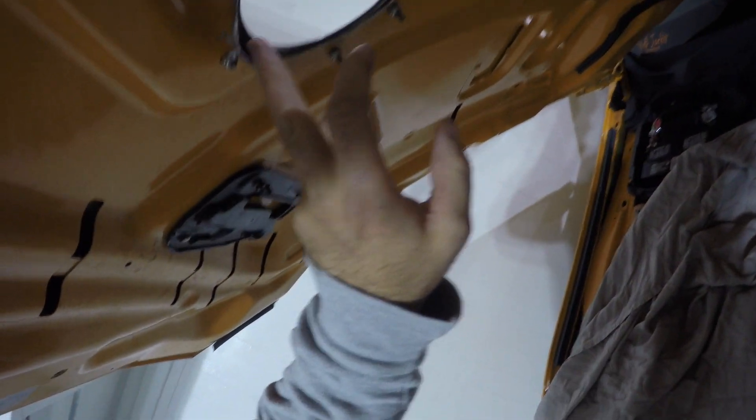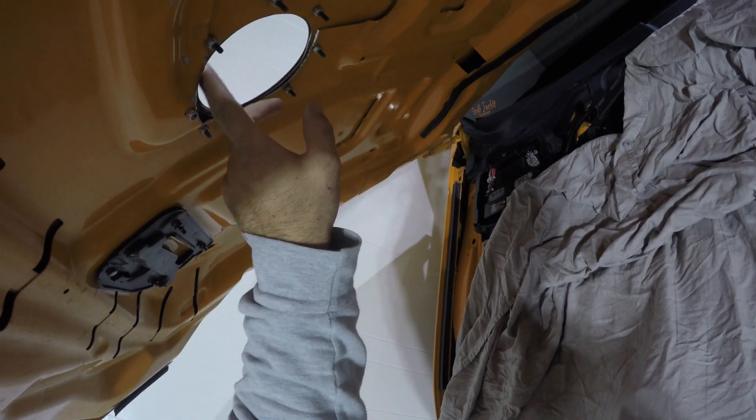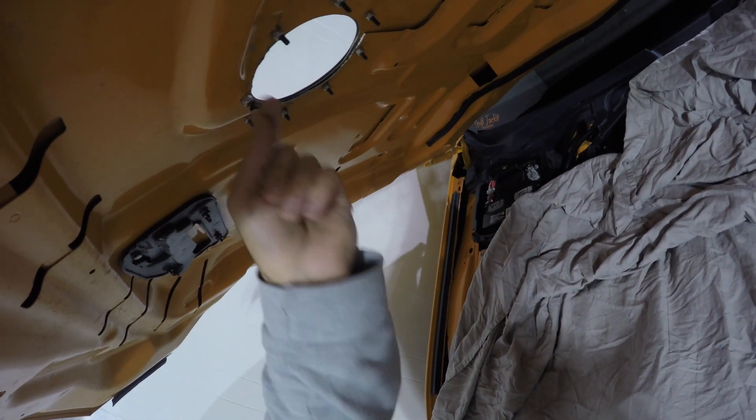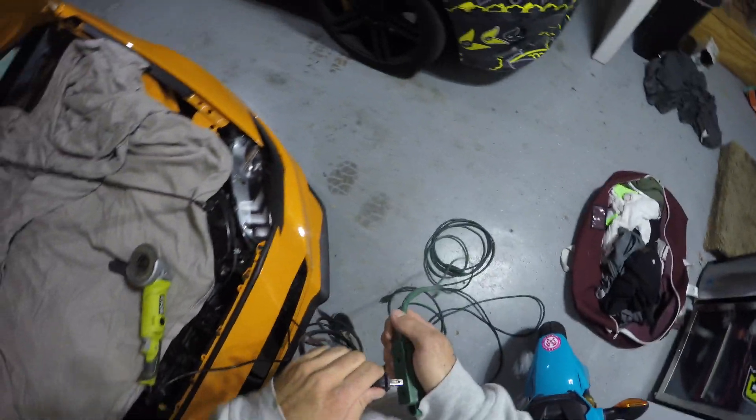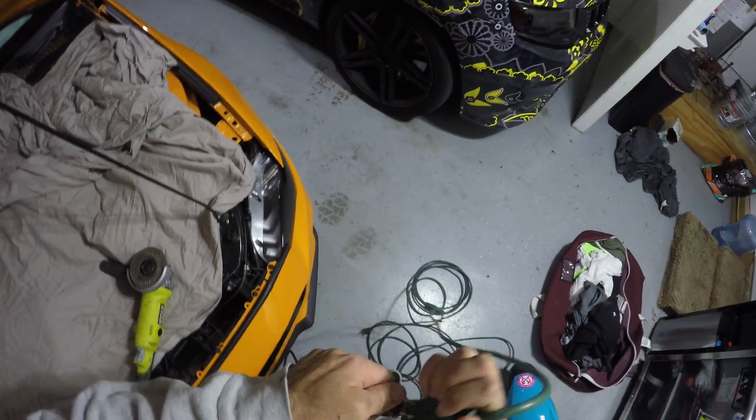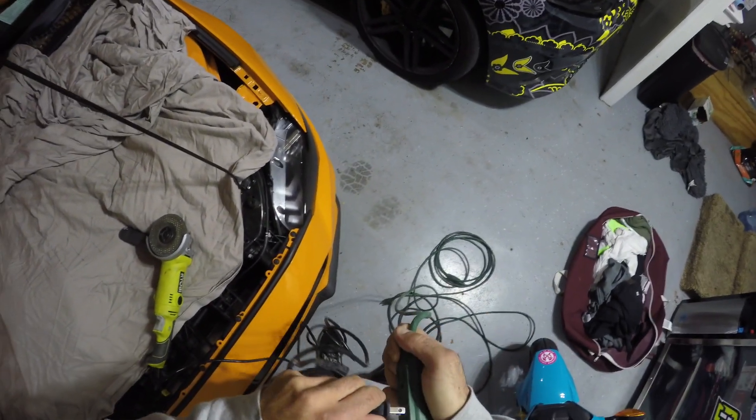This part right here on the inside of the hood is still touching the exhaust and it has scratched it up a pretty good amount. I'm gonna try and clearance this down a little more, clearance the trim ring, and then I think this little nut is still hitting — so we're getting pretty close to just cutting that nut off. We're gonna try and grind that down and see if we can clearance this a little better so we quit ruining this titanium exhaust.